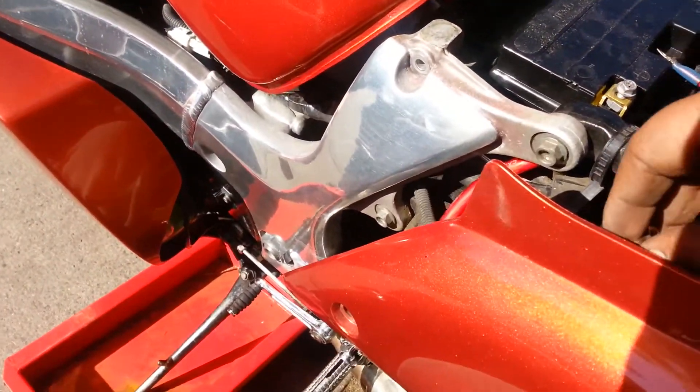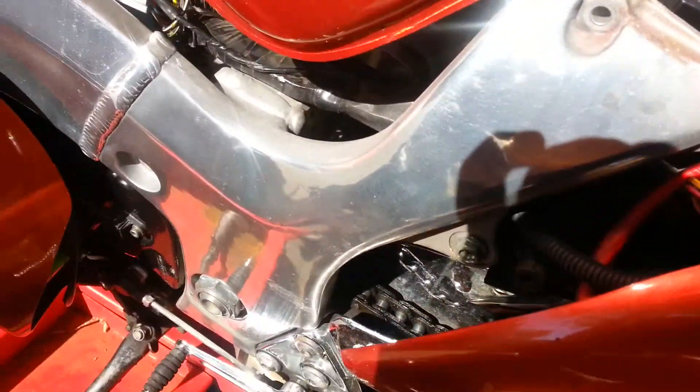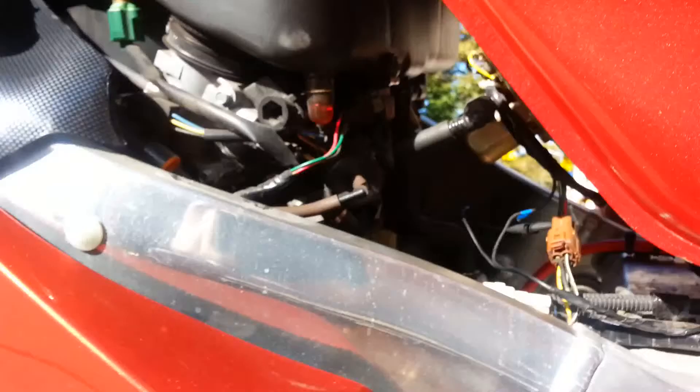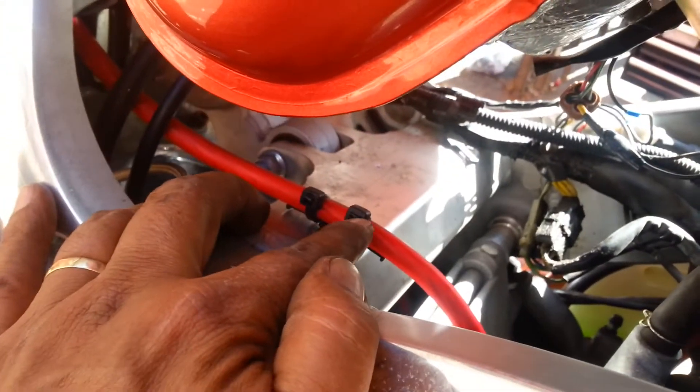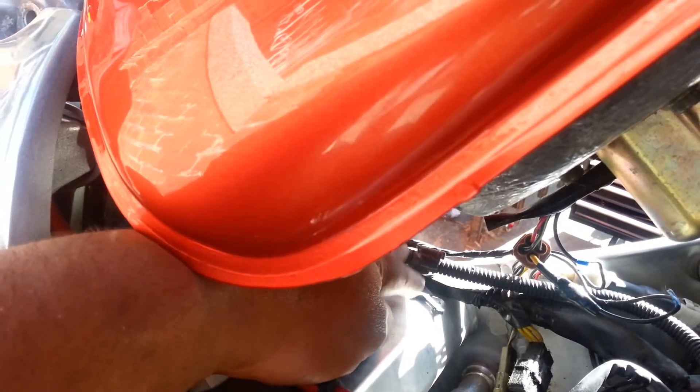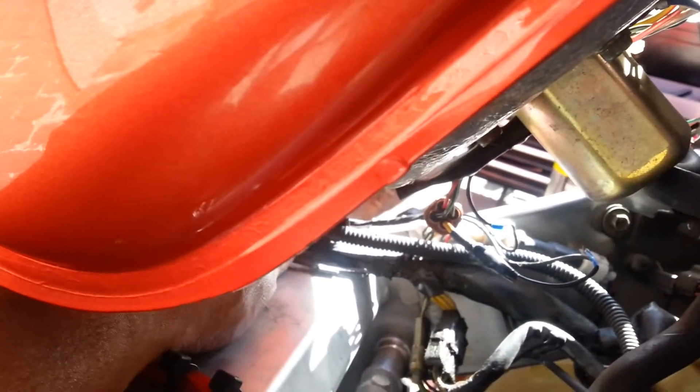This is the second line I just removed off the starter relay. I just want to show you the current route it's taking — nothing fancy or complicated. It uses the same mounting point as the negative. It's kind of like a sled that clips into the frame. Wire tie on this side, wire tie on that side — locks it in place. Somebody had it with just tape, but a wire tie works better. So this is the positive and it's going to route nice and smooth.